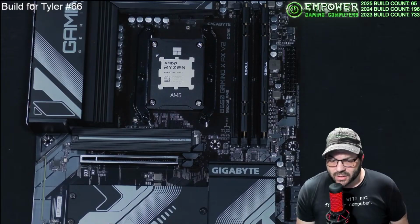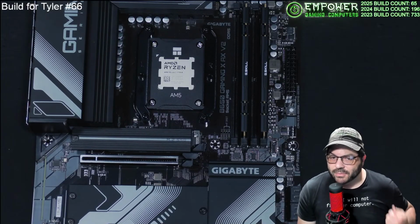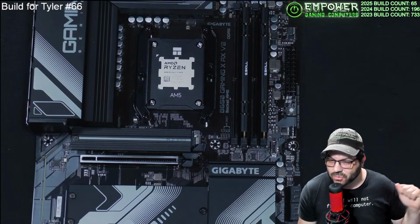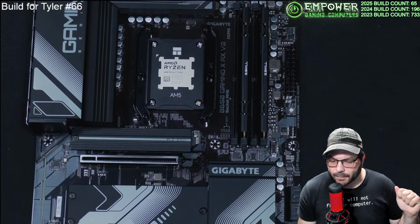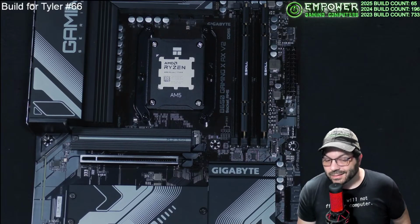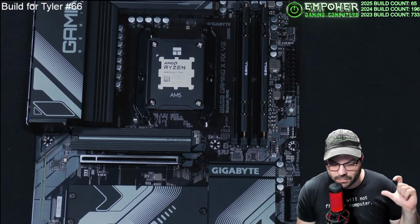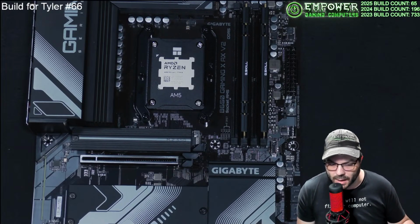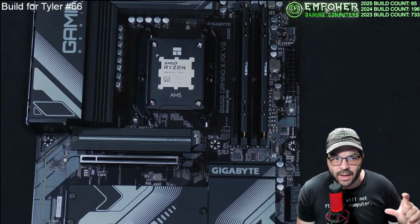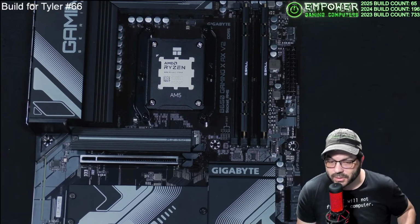But your motherboard is a Strix B650A gaming Wi-Fi. So if you don't have any Wi-Fi and this is your first PC that you just built, more than likely the Windows installation that you installed does not have the drivers for that motherboard. So you'll have to either download them from another computer, put them on a flash drive, and then plug it into your system, install the Wi-Fi drivers, and then you should be able to connect.